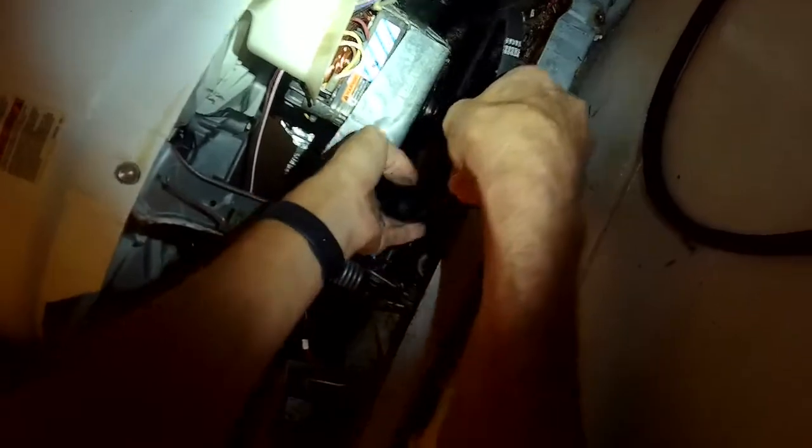And then we'll go ahead and put the belt onto the brass motor pulley on your right, and then over the white pulley about in the middle, and then we're going to start to push it over onto the big pulley as we turn that big pulley to feed that belt on. I'm still just trying to get that belt to get further in underneath the big pulley and further away from me. I want to get it toward the back of the washer. So I'm just wiggling that tub around to finagle that belt into that small little area. I think I got it.